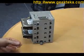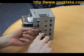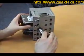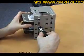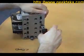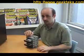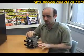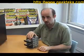You need to use the special screws that came with the case for securing the hard drive — in this case, they're the ones that go in through these rubber grommets here. We're installing the hard drives in the cage, but we're not going to install them in the computer yet. We have some other stuff we need to do first, beginning with the optical drives.